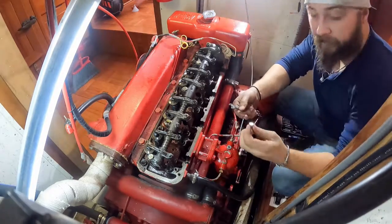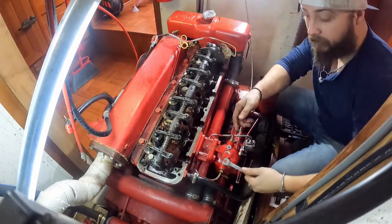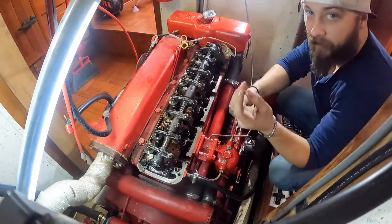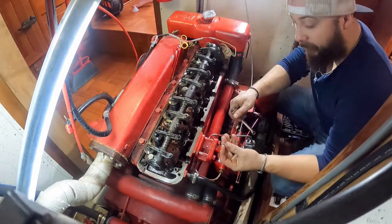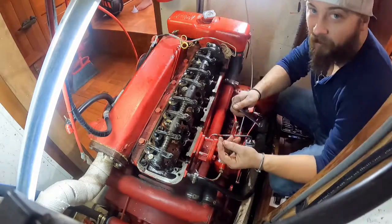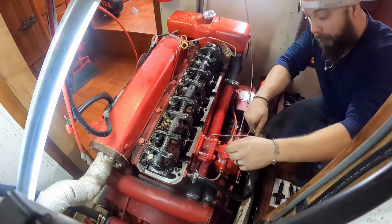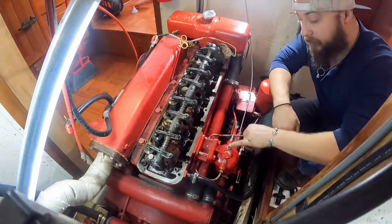Another red flag is the fact that this bolt is different than this one — this is a 3/8 or 10mm, this one's an 11mm, so someone probably tried to shove a 1/4-20 bolt in there. It looks cut off too. If you chase the threads and do it right, maybe it'd work — but I think someone just ripped it out and tried to squeeze something in. It's not going to hold for this situation. Long story short, I'm going to pull this filter off and replace this top piece that the stripped thread is in.